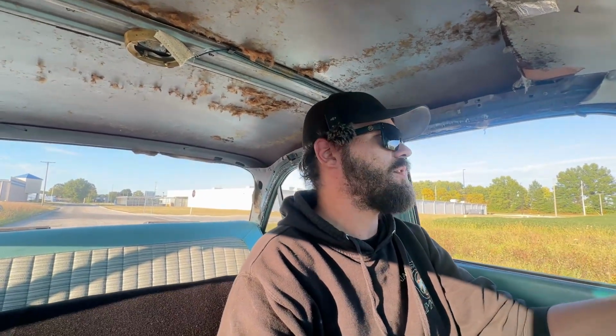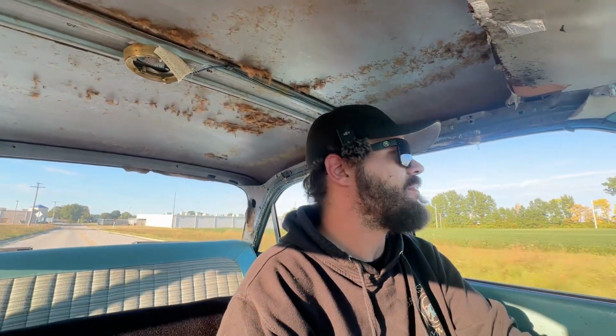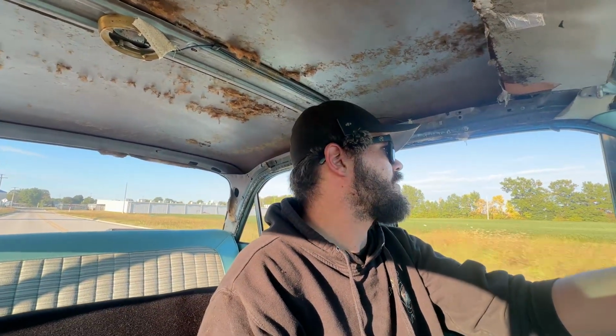All right, we're almost back here to our spot, but like I was saying, this thing is garbage, the trans in it. I'm not sure what's wrong with it. Like I said, you have to put it all the way in drive, or all the way down in 1 for it to even go into first. I'm just gonna flat foot it, and for some reason it just automatically goes into neutral. Maybe you'll be able to hear it. It just revs up. But if you roll into it slow, and then go to the floor, it's just fine, and it'll hold it the whole time. Now we're slow, but we just have to keep that in mind for draggy's sakes. But we're almost back here, and we'll get this thing running down the road real quick.